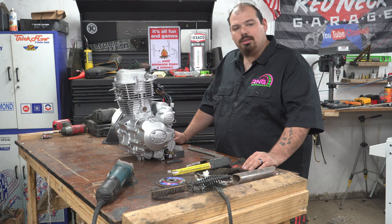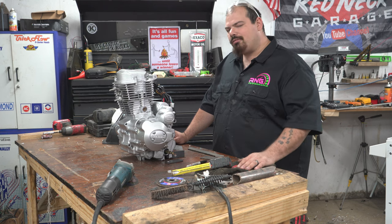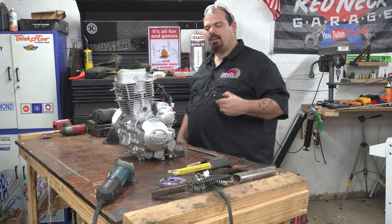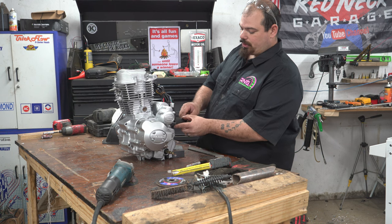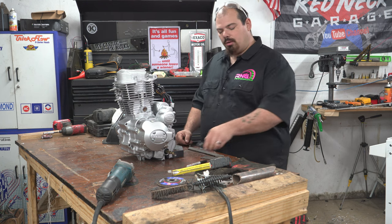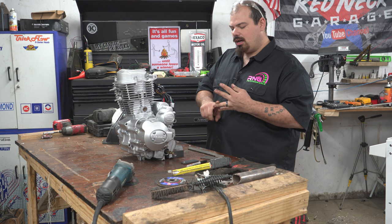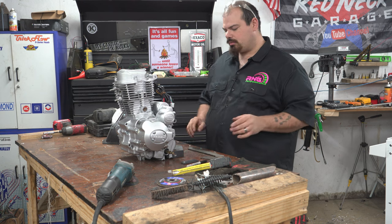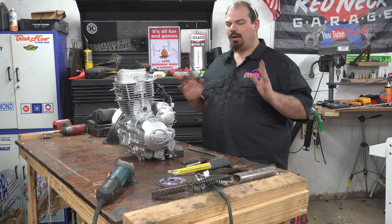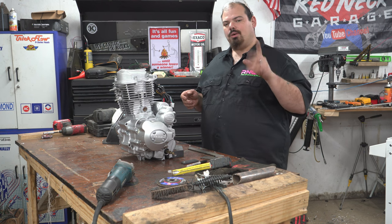Do you think there's something I should change on here? What do you guys think about this build? So without further ado, let's get into it. We're making motor mounts today. I got some brackets started and we're going to get them all tied in front and rear, then get it positioned in the buggy. I already bought the chain and the sprockets we're going to need — hopefully they're the right sprockets. I know they're right for the motor and the chain, but I don't know about gear ratio. We're probably going to have to play with that once we get it going and make minor adjustments.